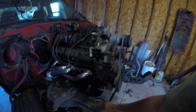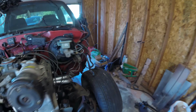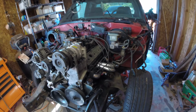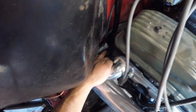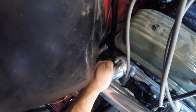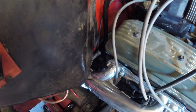But I don't want to, because these motor mounts were really hard to get in position, with the firewall, the brake master here, the brake line, stuff like that. So basically what the issue is, right here, there's a dowel pin, and you can see this part of the bell housing is higher than the back of the engine, maybe a quarter of an inch or half an inch.